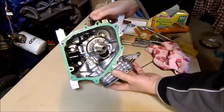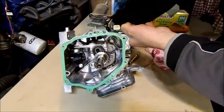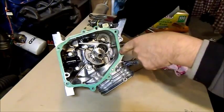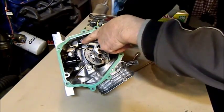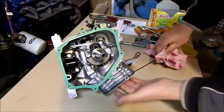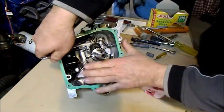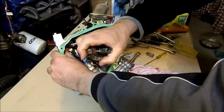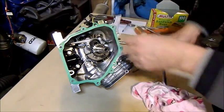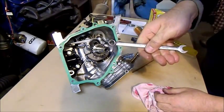What we have left now is called the rotating assembly. It's a good idea to have a good look at how this big end is set up — there's a long protrusion there which has to run a certain way; it can't run the other way. The easiest way to get this off is with the piston at bottom dead center. You can get a spanner in and undo those two nuts — always use the ring side of it. Squeeze against it like that so you don't slip and cut yourself on the castings, because as I said they are very very sharp.